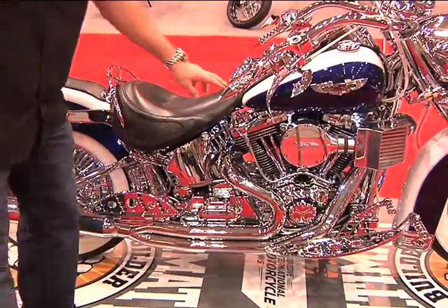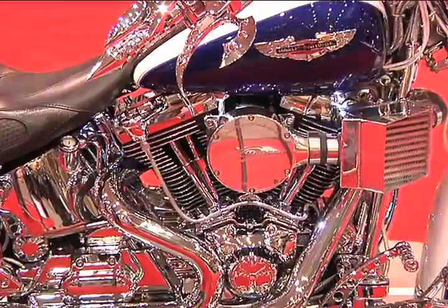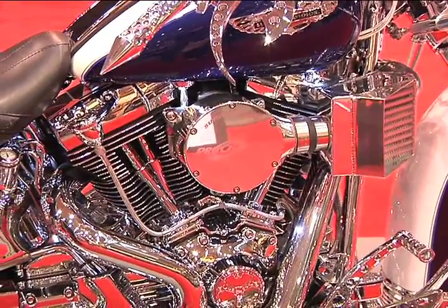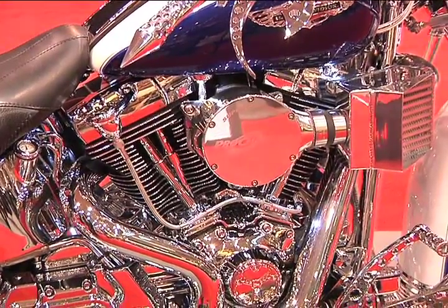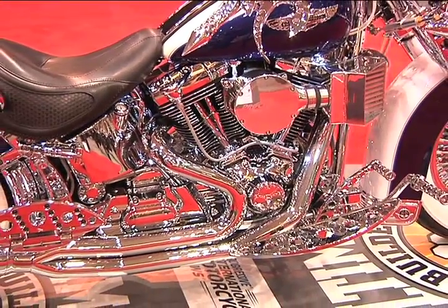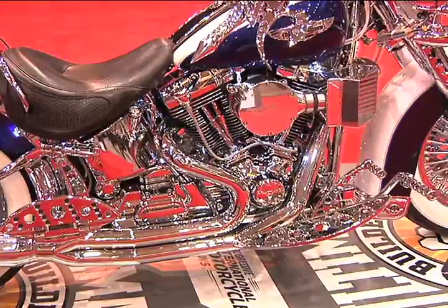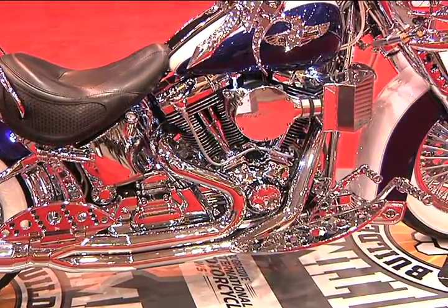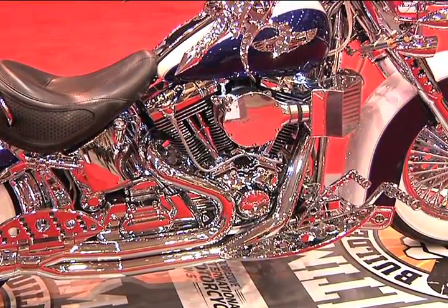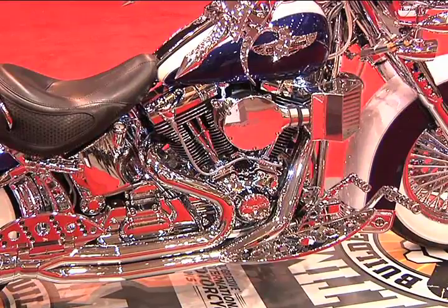If you look at these heads on the inside, he machines them and puts a larger intake valve — a 2.020 intake valve and 1.650 exhaust valve. For the manifold intake it's 1.800, and he makes the exit to the exhaust pipe bigger. Inside the head you notice this 105 cc hemispheric combustion chamber, bronze valve guides — you can see he's hand-machined these things. He's a real purist. As part of the kit, the Stage Four Thumper Series, he's got a three-stage oil pump with two stages that scavenge oil from the bottom of the motor and one stage that flows oil back into the motor. He also created a 662-1 cam that is perfectly timed for forced induction motors.